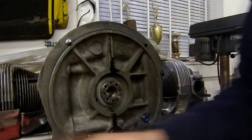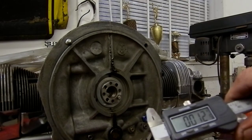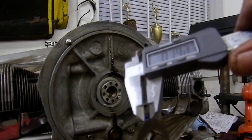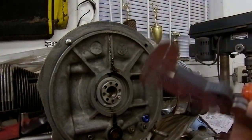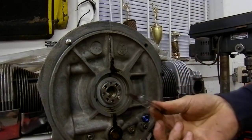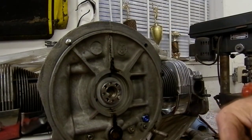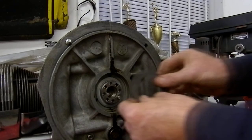I've picked up some brand new shims and it's a good idea to check them with your vernier caliper — just to make sure they're all at 10 thou. Checking each one: 10 thou, 10 thou, and the last one — 10 thou. So if I put three 10-thou shims in there and bolt it all back up, I should have about three thou of end float. There was some calculation involved with which bearing to install in the case to compensate for end float.